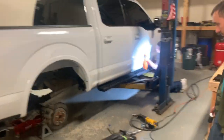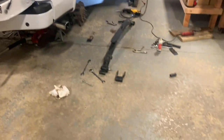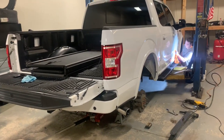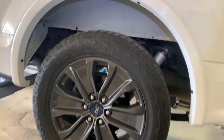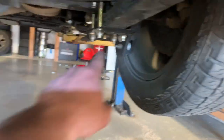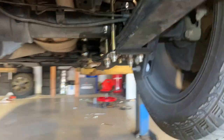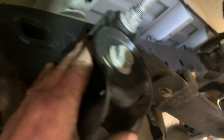Vinyl's off, Kevin's doing some detailing, and we're getting the leaf springs back in. It's coming together — it's starting to look really sick, totally changed the look of the truck. So we got the back complete. Pretty simple process: just flip the axle wrap around on the springs — the rear was on the bottom, we flip it up on top. They give you all the necessary hardware. Mount the shocks up, same process for the other side. Not too crazy — they give you some shackle extensions.